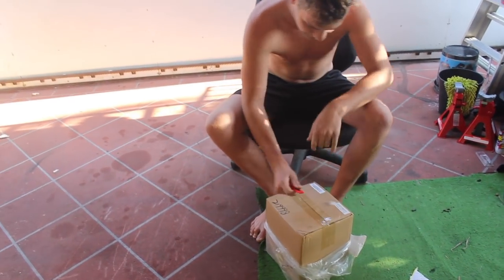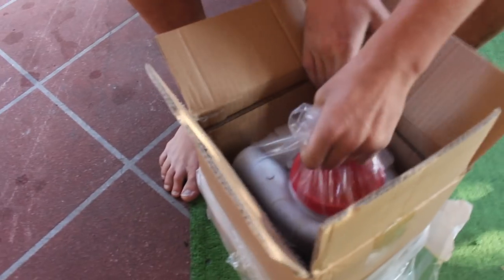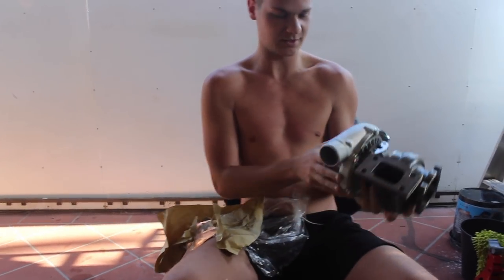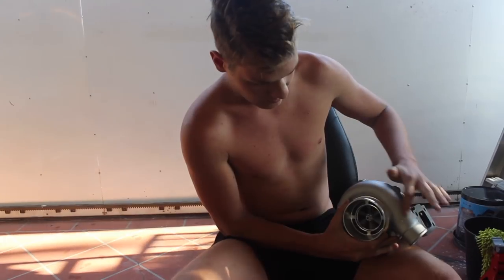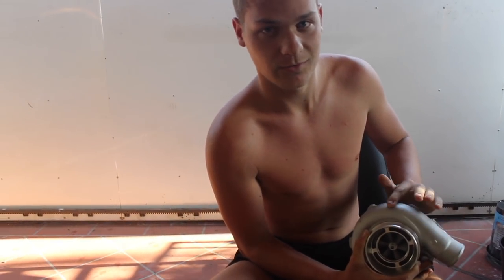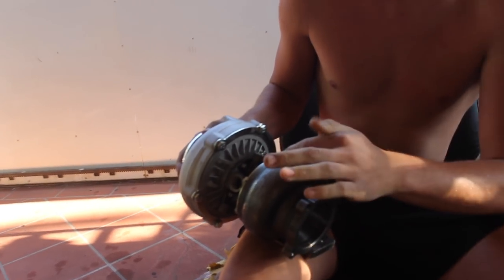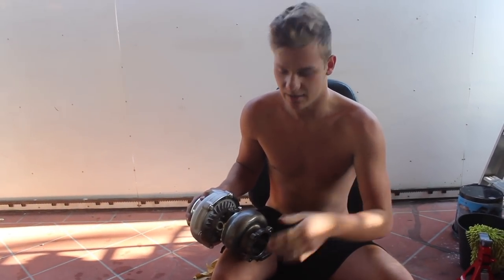Hopefully I've got everything here. Dude, it's engraved — no way, it's so big! The front housing is pretty similar in size, but the blade is bigger. The flow rating of this is 0.60 AR, whereas my old one was 0.50 AR. It's also got anti-surge. The main difference is the rear housing: the old rear housing was 0.57 AR and this one is 0.82. The bigger the rear housing means it takes longer to spool up, but once it is spooled up it has a lot more power up in the higher rev range.